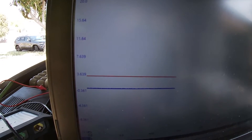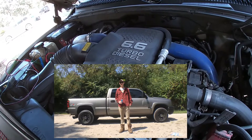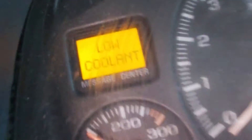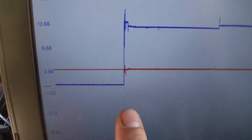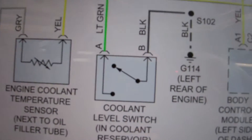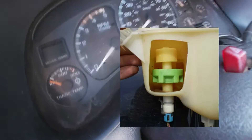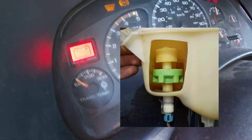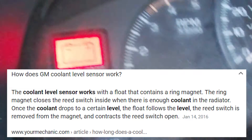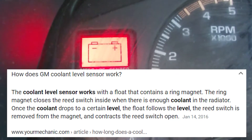What's going on viewers, Diagnostic Dennis again. We got a '01 Chevy Silverado with the 6.6. One of the three reasons we're here is low coolant. What happens is the PCM sends 12 volts on the signal wire — the coolant level line on the light green wire. You also got a ground wire. It's a magnetic float — it floats in the coolant but it's a magnetic switch. We're gonna go key on and observe the problem, which is a low coolant light.